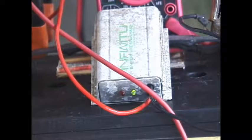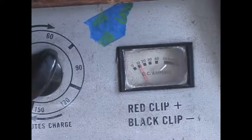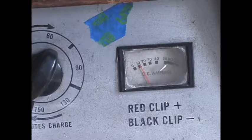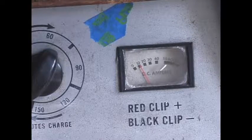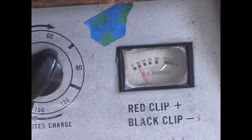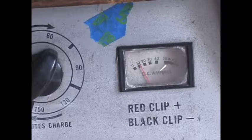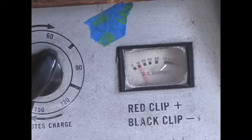I've had a couple of the $35 desulfators using high-frequency, and my impression is that they have little effect, though others have had good success with them. Initially, if the battery is completely dead and has sat for a long time, I would use a high-amperage voltage charge to start it going — it may take hours to get going. Any reading on the charger showing some amperage being delivered to the battery means it's starting to charge. In this particular case, the charger has started to get up to 10 amps. If it won't take a charge, I would use jumper cables to a good known battery and start the charger charging for 15 minutes, then disconnect it and see if it will start charging on its own. Some chargers won't charge a battery they can't see, and often they can't see a battery with less than 4 volts. Once it starts charging, I would lower the amperage setting and let it go for 8 hours or so and see what voltage it will eventually get up to and what the hydrometer readings are for each cell.